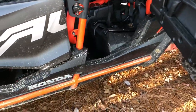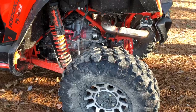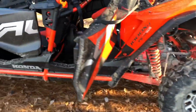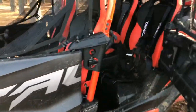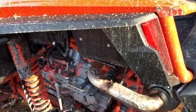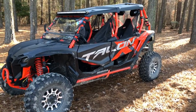After cleaning the grounds, I went to start the bike but it still started up for a couple seconds and then cut off. I ended up taking the positive and negative off again, let it sit for a few minutes to reset the computer, put it back together, and it did the same thing. Finally I got it started, revved it up a little bit, and let it idle high for about 30 seconds — and it ended up staying running with no more problems after that. I think the computer just needed to reset. So before you go on the trail, make sure you check your grounds because it can definitely mess you up out there. Thanks for watching — let me know if you have questions, and like and subscribe if you enjoy the content. More videos coming soon!